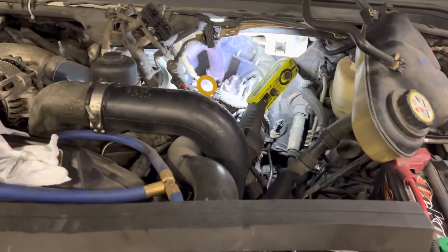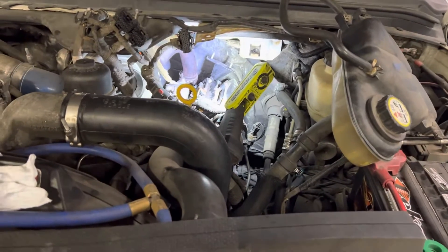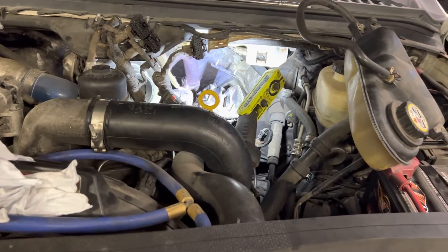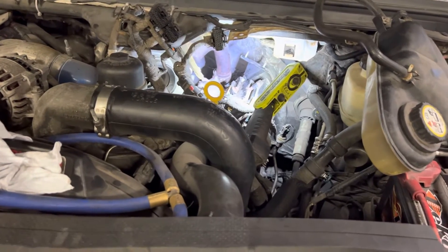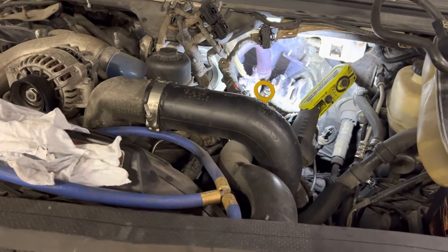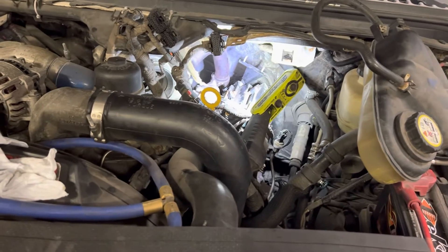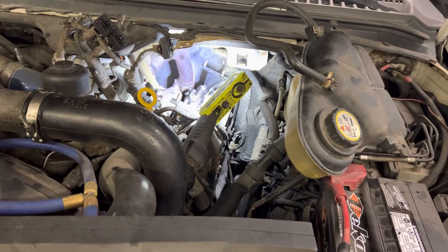I had it pulled out, it was running for a little while, and I blew all the dust off. As soon as I got in, stepped on the gas, put it in gear, and stepped on the gas — it just shut off. First thing that comes to mind is the HPOP. I checked everything — all the values. They say if it's either at 15 or 85 percent, the IPR valve is most likely bad and won't build enough pressure to start the system. I ran it through my computer — it was at 85 percent, and my ICP sensor was showing only 755 and wasn't building any pressure or changing, so it won't start.